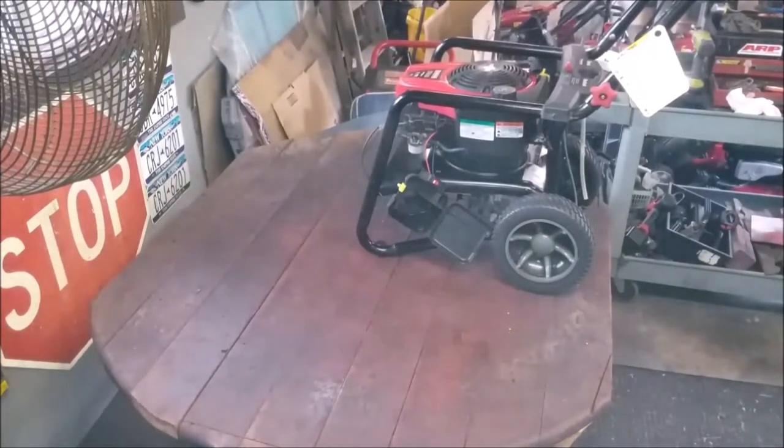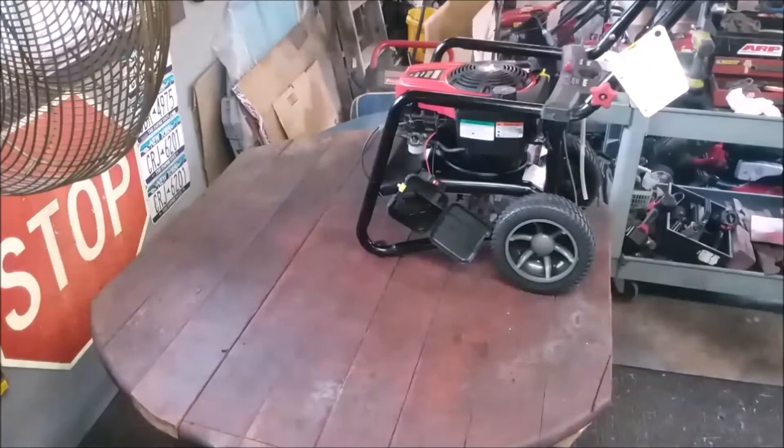And this will be some kind of a backup, a parts machine. So we don't want to keep running the pump dry too long. But by the way, pumps wear out more when they get hot, and they get hot by compressing water. There was some water in there, and it's not hot, because it's not compressing anything. So you have a little bit of time to test an engine before you get that involved.